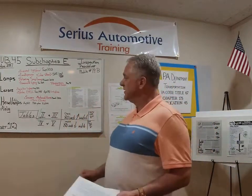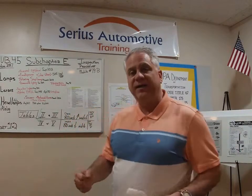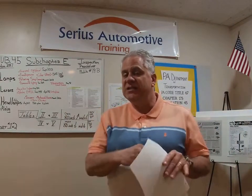We're going to pick up here with some information on center-mounted stop lamps. Some people put an additional spoiler on the back of their vehicle that's mounted on the trunk, and that has another center-mounted stop light. Then what the customer will do — or the dealer — they'll disable the one that's inside the vehicle.